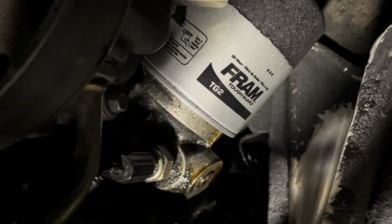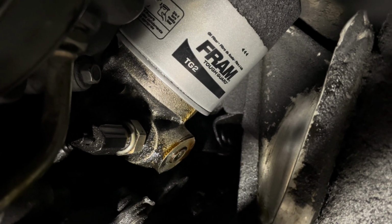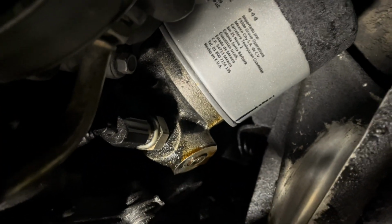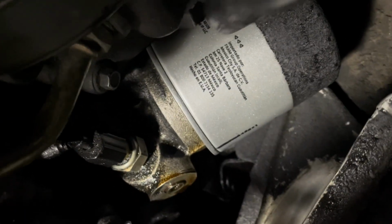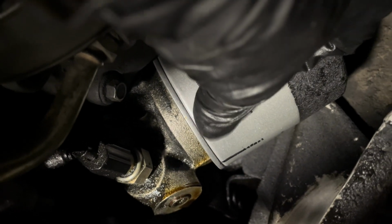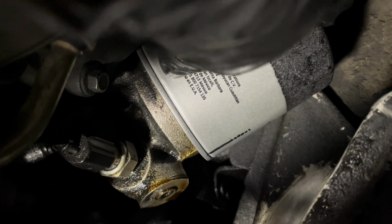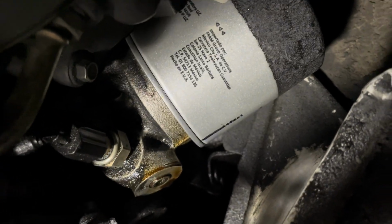All right, so now put my wrench back on here. I'm gonna pause for a second. Okay, so I tightened it with the filter socket, and it got pretty tight, and I felt it. So if you can see it where my thumb is right here, that's my mark, and that's enough. This would have been 1 full turn, and that's 3/4. 3/4 felt tight enough for me, okay? It's kind of a feel thing. You don't have to crank this super tight because you'll squeeze out the gasket, and that should be all right.